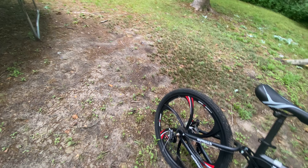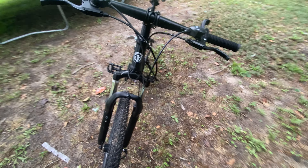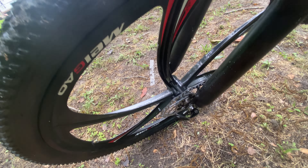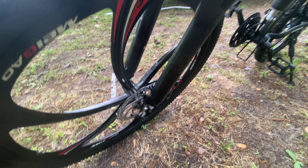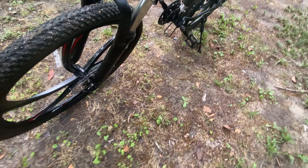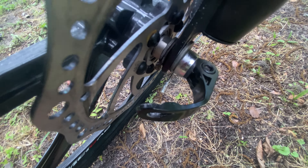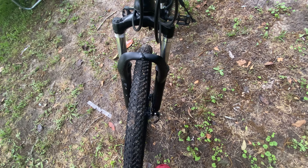I really like the rims. The only problem I had while working on this bike was this little silver piece between the clamp and the wheel — it wasn't exactly centered. What I did was put a few washers in there, two on the outside and two on the inside, and it held it in place pretty well.